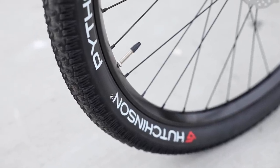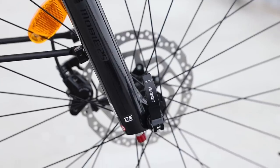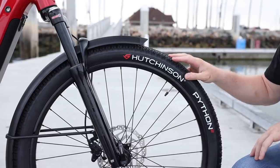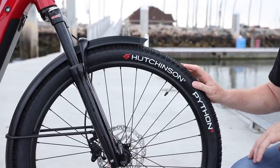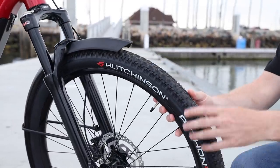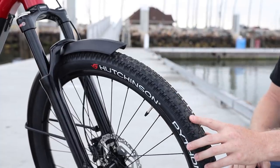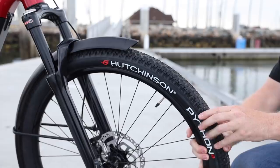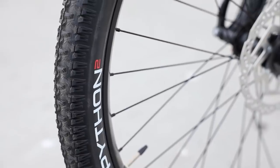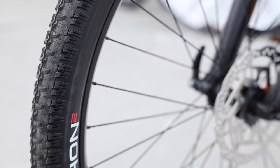For the wheels on the X-Road, you have a 27.5 double-wall aluminum rim, pretty heavy-duty, with a thru-axle up front on this one. Some of the models might have a standard quick-release front axle, but they all have the same Hutchinson Python tires. These are 27.5 by 2.1. The tread has a relatively aggressive side pattern but the center is not as aggressive, so it performs really well on the street and off-road. This bike is really great for people that want that all-round sort of riding style. These tires also have good puncture protection and it is possible to set them up tubeless, which is a nice option if you're riding off-road more often.